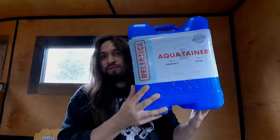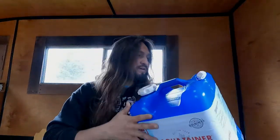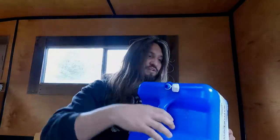And also, third thing. This is going to complete it. You can pick whatever water tank you want. I picked a big old 7-gallon water tank for my camper. And then I drilled out the air hole, and that's what I'm going to feed into it to take for water. And I chose this over the stock container because the stock container was just super flat and you couldn't remove it. So you had to fill it from outside.